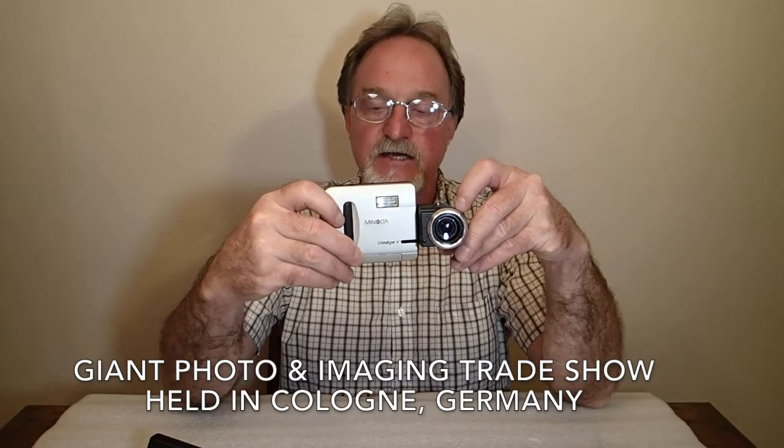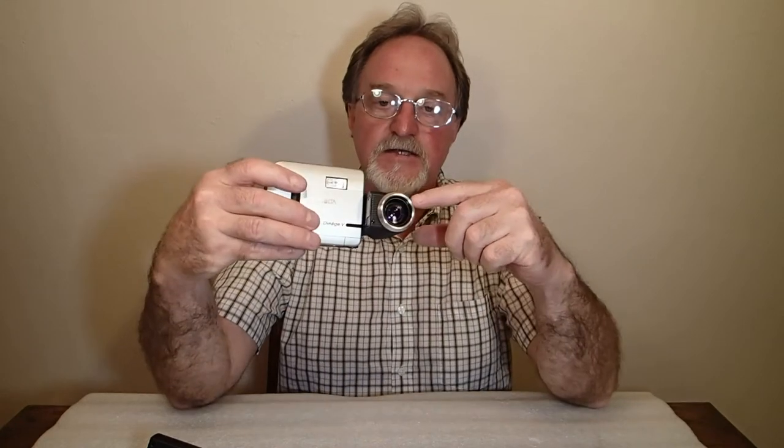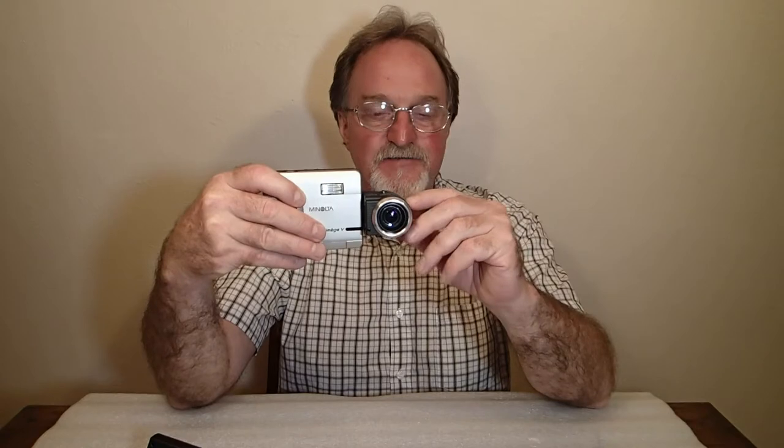It used to say D-Image, but I found a video from Photokina in 1996 where one of their reps said 'Dimage.' It has a rotatable, extensible lens, 4.8–13mm, which is 34–92mm in 35mm equivalent. I've used this rocker for tele and wide, and then all the way over in this detent it's macro. Macro is good from 5cm to 9.5cm. It's a pretty sophisticated lens for something this old — 9 elements in 7 groups. The aperture is fixed depending on the zoom range; you can't adjust it once you're at that zoom range. It goes from f5 to f5.6. It's fixed focus.